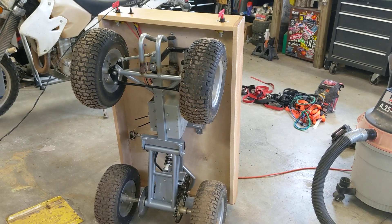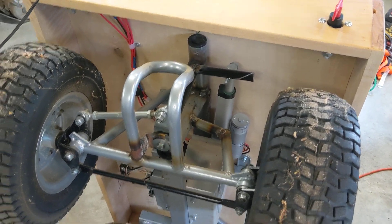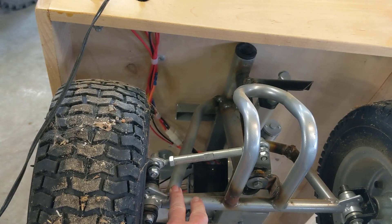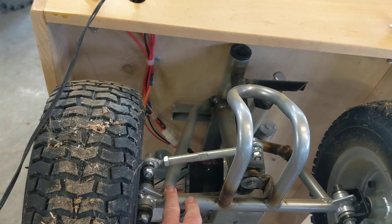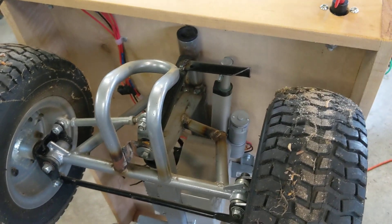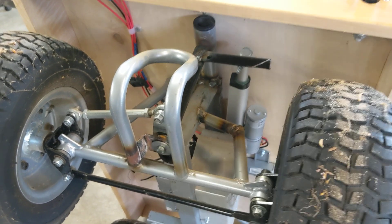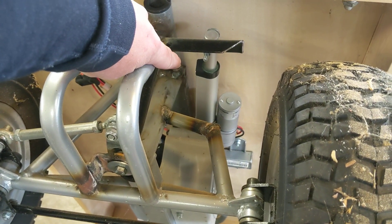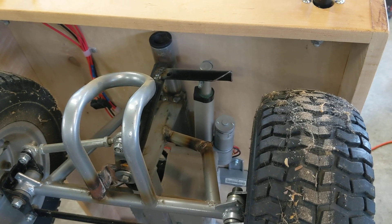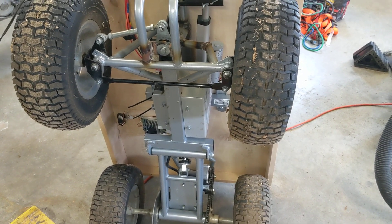The only other thing I did was for the front brace up top here — there's a brace that goes all the way up and connects to the top tube. I had to bend and re-weld it because it used to go up higher to where the steering bar used to go. On this side I had to triangulate it a little differently to attach a little lower, because where it was originally it would have interfered with the steering servo — the linear actuator I bought. So that's the basic modifications I did to the Razor 4-wheeler itself.